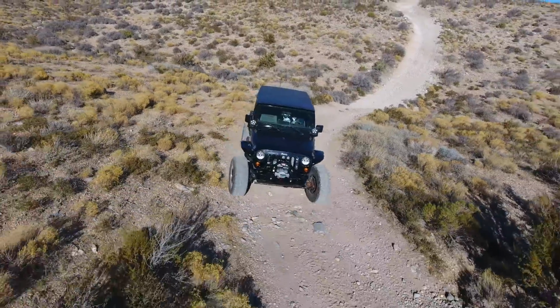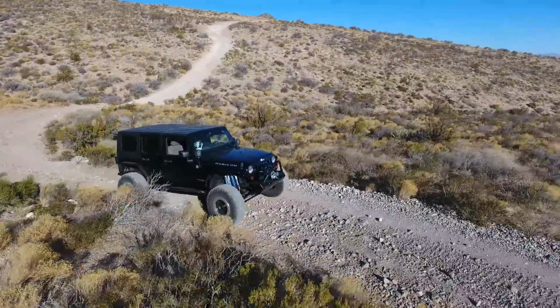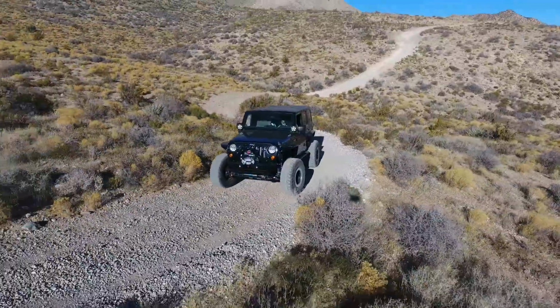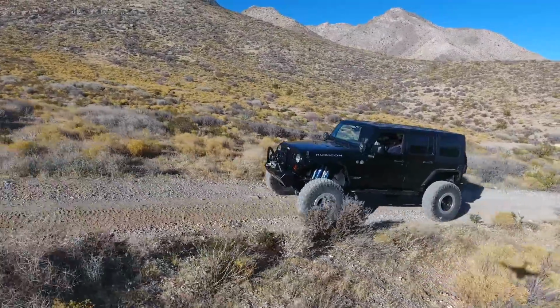Third advantage of the easy mounts is it's reversible. You could literally put your V6 back into your JK if you chose. A fourth advantage of the easy mounts is in some countries you're not allowed to modify the frame. So we're not doing any frame modifications with our easy mounts. We're not touching the brake line. It's literally a bolt-in swap.